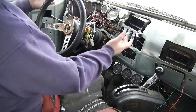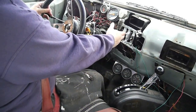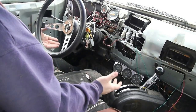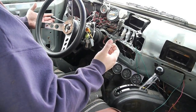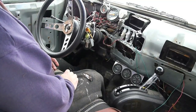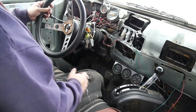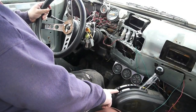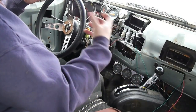You can be driving at 100 miles an hour and shift it into first gear — I don't know if that would damage the transmission, but it won't decelerate your vehicle. If you want to decelerate with engine braking, you need to use a manual shifter of some type and control the linkage.